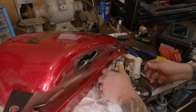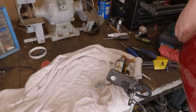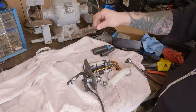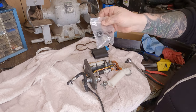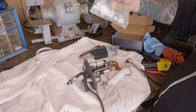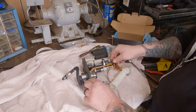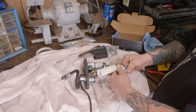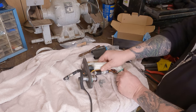Now set that down. We have our old sending unit here and our new one with a new gasket, new fuel pump, new rubber thingamajigger, new fuel pressure regulator, new plastic hose, hose clamps, filters, other clamps, and pickup screen. I'm going to carefully disassemble the old unit. Apparently I'm reusing the filter housing, so first things first — I'm going to take this clip off the pressure regulator so I can remove it. We have a new one, so set the old one aside where old parts go.